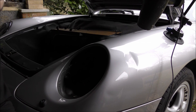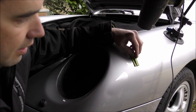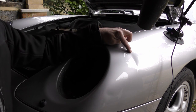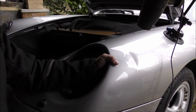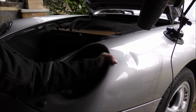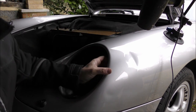I'm still going to finish it with bars and rods, but we're going to take a bit of a chance with the paintwork and try a glue pull here. I'm going to use this green tab — just a smooth series — put a line of glue on it, place it in line with the crease, and then give it a gentle pull with the slide hammer. Some of the dent has already started to push out from the inside and it's fairly soft. The only reason I'm cautious about the paint is from experience with older vehicles — sometimes older paintwork can be a bit brittle for a glue pull, particularly when it's cold. Hence why I've got the hairdryer set up, giving constant heat to keep the panel and paint nice and warm.